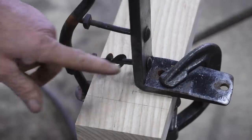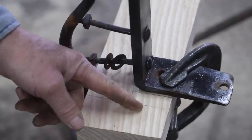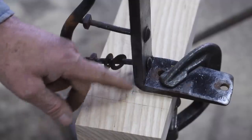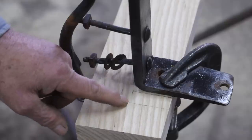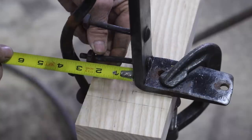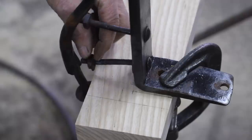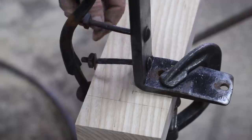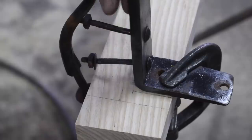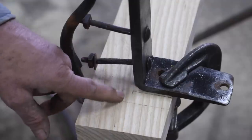Well, I'm still puzzling over this back joint here. This is where I thought maybe the tailgate end gate would be, 3/4 inch from the 8.5 feet. But something was bothering me. One was the length of these bolts here. I have 2.25 inches on these bolts. So there needs to be the 1/2 inch for the little raised side, 3/4 inch, so there's 1.25 inches. So I have a 1 inch difference, there must be some type of framework. So I was puzzling, how did that get jointed in there?